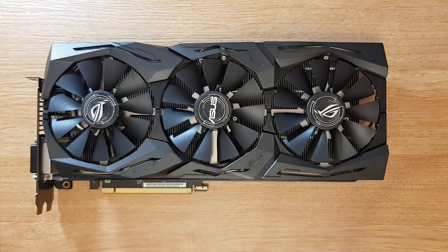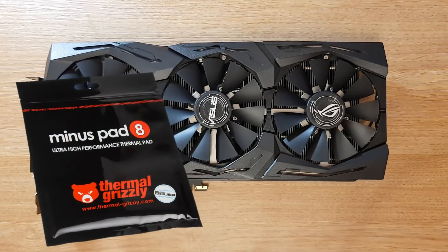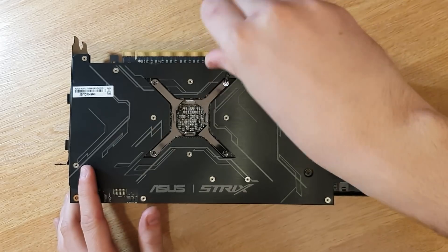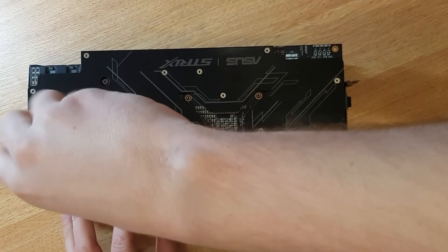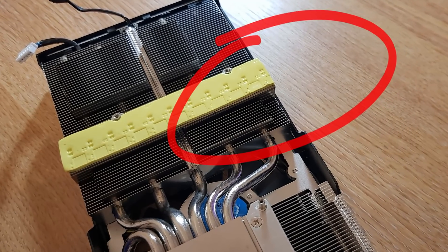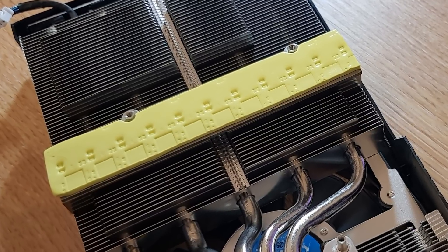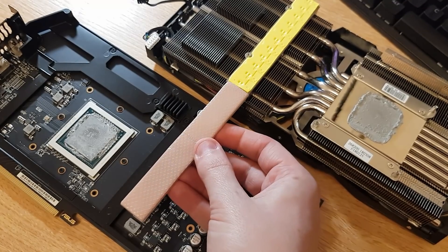So with that done and a full set of data logged, it's time to apply the new thermal pad. We're using a Minus Pad 8 from Thermal Grizzly, 20mm x 120mm x 3mm thick, and it was purchased off Overclockers UK for around about 12 quid. The Strix Vega 64 comes apart really easily with just 6 screws holding the cooling solution to the PCB, 4 around the GPU and 2 at the rear. And once the fan and RGB cables are unplugged, the card simply comes apart as you would expect, with no hidden issues. Looking at the OEM thermal pad, you can see where the issues may come from. Contact to the VRM is haphazard at best and pretty shocking at worst, with it completely missing some of the VRM components while not really offering full coverage to many others. The thermal pad we're changing to is not only a little bit thicker, which will actually spread out when it's tightened up, but it's also longer, ensuring that lone FET on the outermost side of the card is going to be fully covered when we reassemble it.